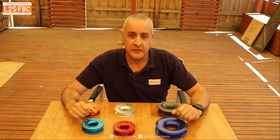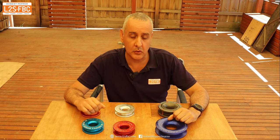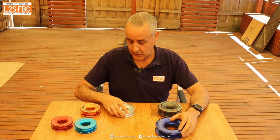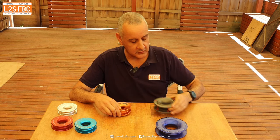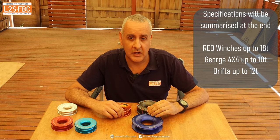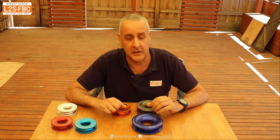Working Load Limit is the amount of force the ring is actually designed to take — not the force at which it will break, which isn't stated for any of these. Most of them have an 8,000kg WLL: the Red, Drifter, and George. Camp Boss is rated to 10,000kg, Factor 55 to 9,000kg, and Saber to 12,500kg. Even so, 8,000kg is plenty for a four-wheel drive of three to four tons, so I have no concerns about strength with any of them.